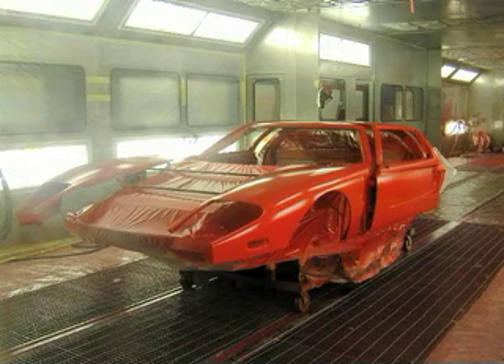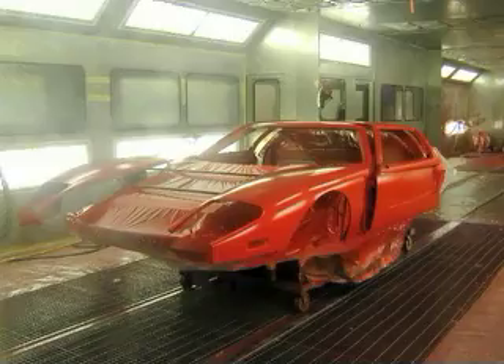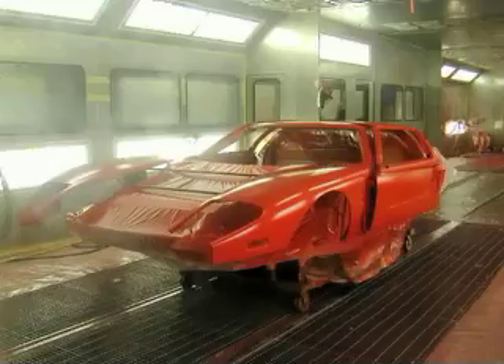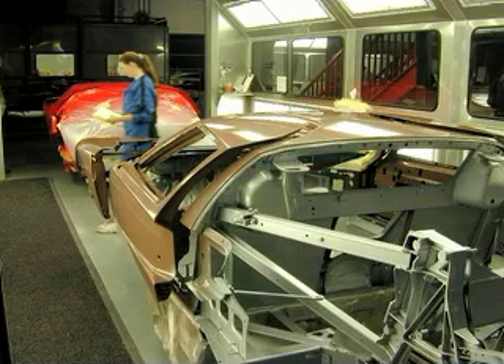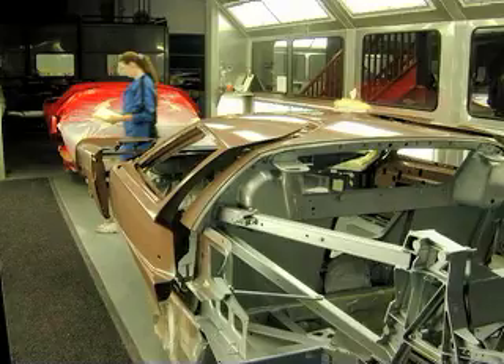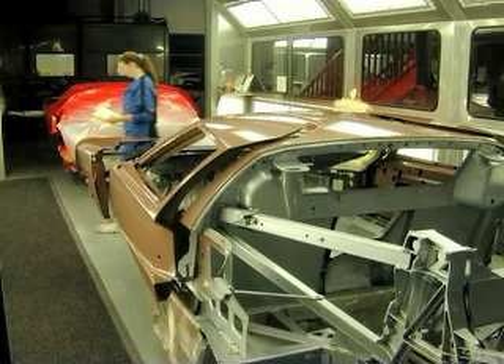After an inspection of the body panels at the primer stage, the base coats and clear coats are applied. Between each coat, there is a 5 to 15 minute wait to allow the paint to settle. Paint masking is also checked throughout the process to protect the interior body panels and silver chassis from unwanted overspray. After the primer coats, and again after the base and clear coats, the body panels are inspected for flaws and defects in a well-lit booth. Some defects that might be hard to see at the electrocoated inspection stage will turn up here and are immediately addressed.